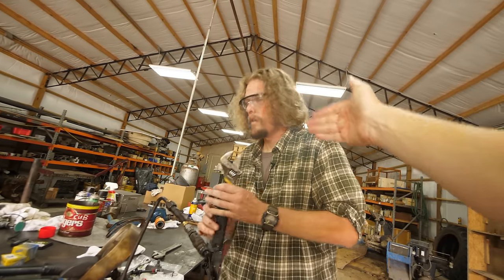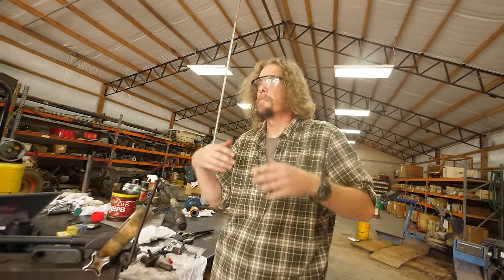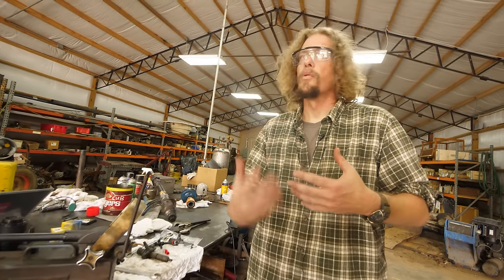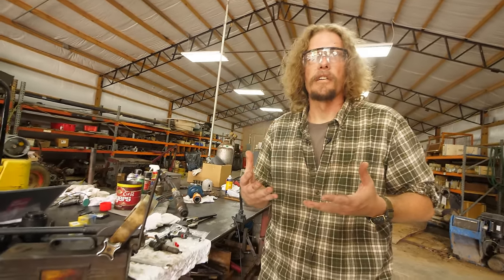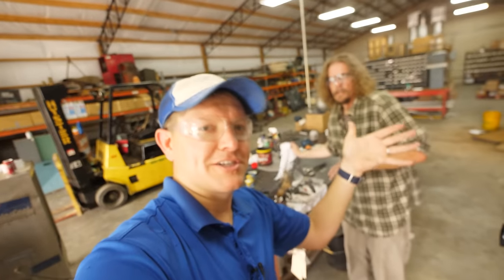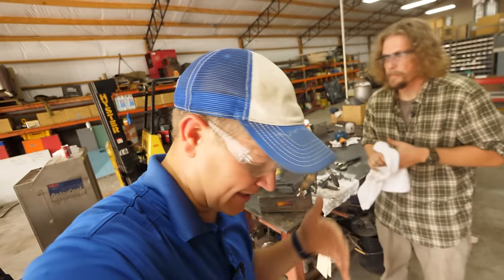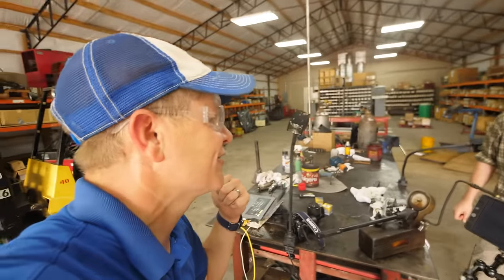If you get too much on one side, you get an uneven combustion. Like if you get too much fuel on one side of the cylinder, it won't burn completely, and you'll end up with black exhaust smoke, incompletely burned fuel, poor fuel economy, and eventually engine failure. So basically, you'll have a rich side of the engine and a lean side. Correct. And so that affects temperature and stuff like that. That's interesting, because on the carburetor, everything happens upstream from the inlet.